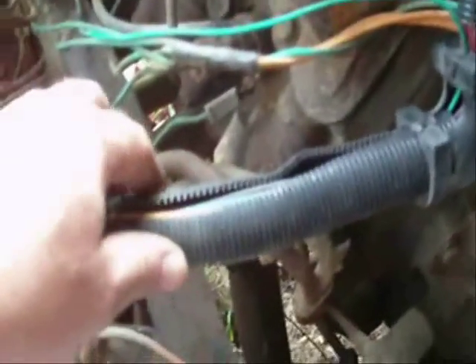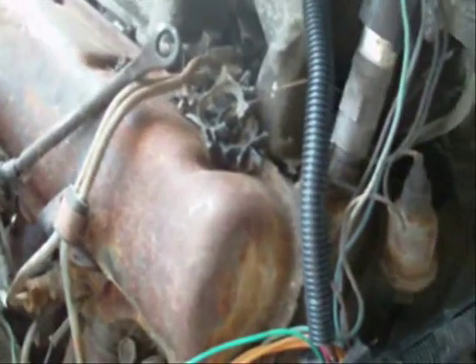I've got my wiring loom finished up. I did have to move this one from the other side — I realized that this connector here was two smalls and a large, and this one needed a small one, so we swapped them out, put the big one on here, and I'll go back and put some electrical tape on there to keep it closed up. Next time I'm going to be removing this intake manifold so I can get at that fuel pump up under there.